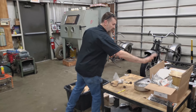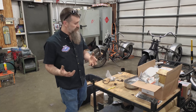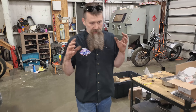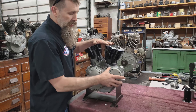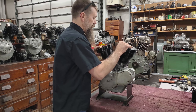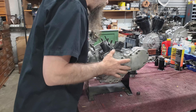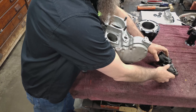We've got a small pile of reproduction parts. Inevitably, all the original components — it's just impossible to find everything. So there will be some things on this bike that are reproduced by the best available sources, and we're going to go over some of that stuff with you later. Now when it comes to the heart of this motorcycle — the engine — 1937 Harley Davidson 61 cubic inch knucklehead engine. To find a '37 engine nowadays is incredibly rare. We're starting here with an absolutely minty pair of '37 original matched engine cases. These have had one of the motor mounts repaired, very nicely repaired. And a set of early tappet blocks — just a couple years only for these tappet blocks.